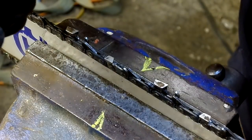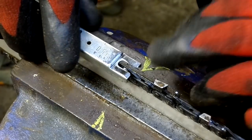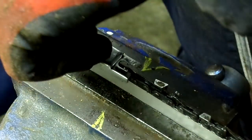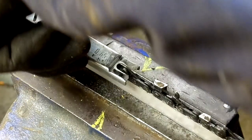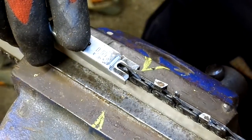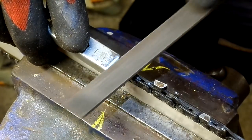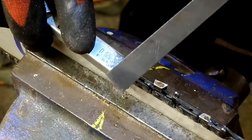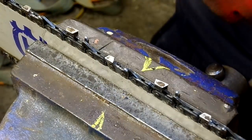I use one of these out of the Husqvarna kit — all it is, you put it over the top of the raker, pull it back to the raker at this angle. Put it on, pull it back to the raker, and then just forward swipe. Always use this bias forward. I'm left-handed — that's the problem here. See it taking it off? So it's going flat there. You're going to round that off — don't leave it like that, just round that front off. Like that, then do the next one exactly the same.